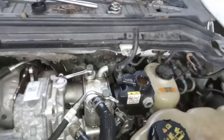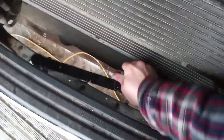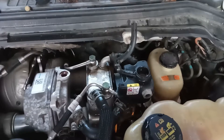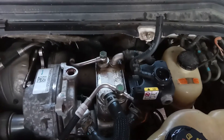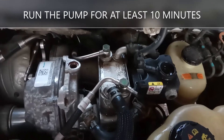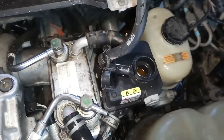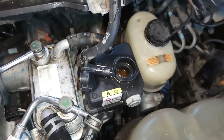Okay, time to turn the pump on. I've pulled the heat exchanger up — shaking it around can be helpful. You can see that the coolant level has dropped some. You're basically just going to want to play with the hoses a bit and shake that heat exchanger around, and just let that coolant pump do its job to get as much air out as it can. Another thing that helps is unbolting the reservoir and just lifting it up a couple of times — I find that always just gets a little bit more air out of the system.